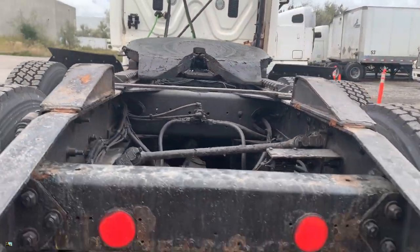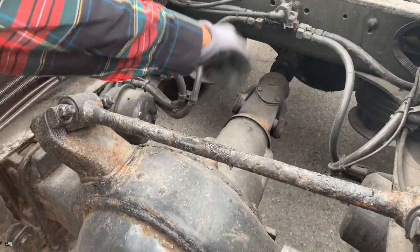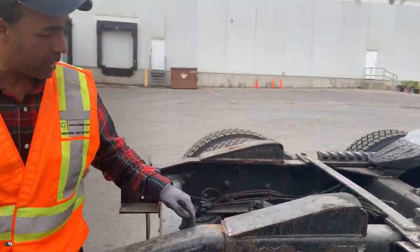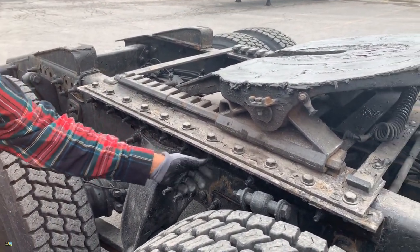Then come around to the back of the truck. Check that your four-ways are working. Check your tie rod, your differential, your brake chamber, your airlines, your drive shaft — make sure all of them are looking good. Airbags looking good, no crack, no damage. Then do the same thing on the other side of the truck: fifth wheel frame, no crack, no damage, all the fasteners are tight and secure.